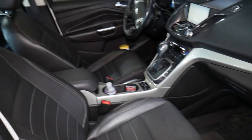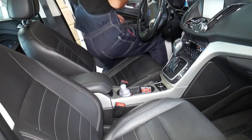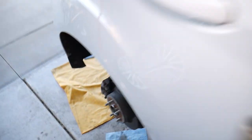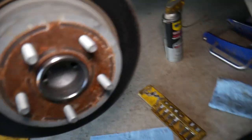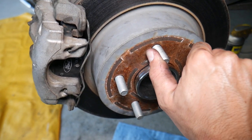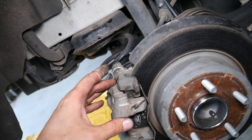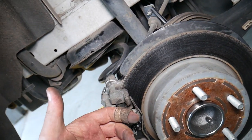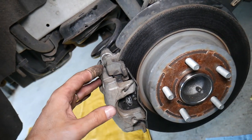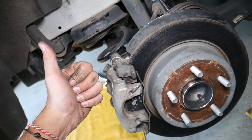One person needs to go inside and pump the brake pedal as much as possible — pump, pump, pump. Make sure the emergency brake is not on. Hold the brake and press the pedal all the way to make sure it's holding firm and the brakes are working. Otherwise you'll have a soft, spongy pedal the first two or three times you press it. When you start the car and put it in drive or reverse, the brakes will not work those first few presses — so pump out all the play from the caliper we already compressed. Hopefully this video was helpful; thank you for watching and see you next time.